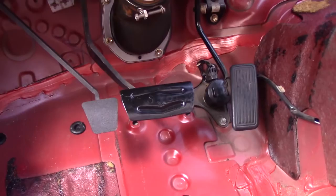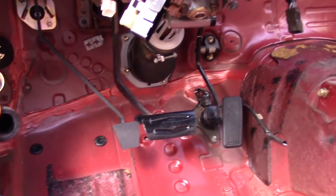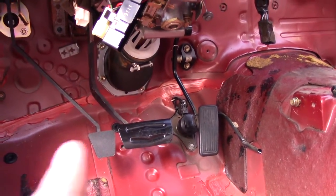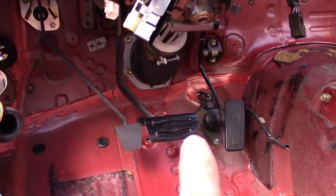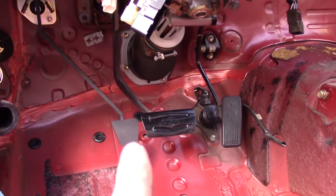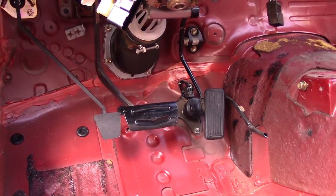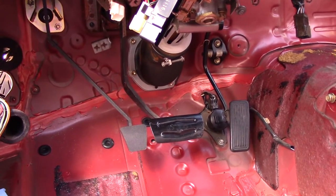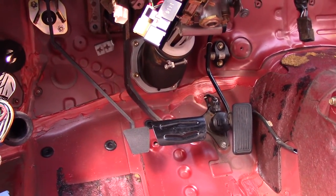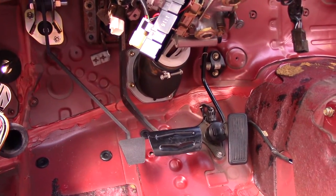This is starting to look like a car again. Here we have our clutch pedal installed. The brake pedal is huge because it's the automatic pedal, so what I'm going to do is cut the left side off. Gas, brake where my finger is, and then the clutch pedal — this part will be trimmed a bit. I'm not going to cut that yet though because I haven't figured out my braking system. I'll likely be removing the brake booster, which might change the pedal location, so I'll wait until the brakes are sorted.